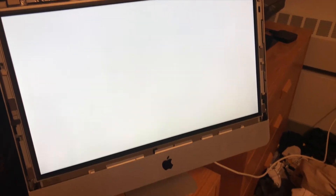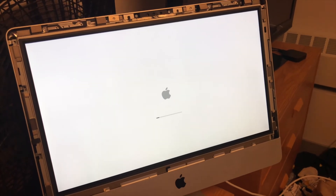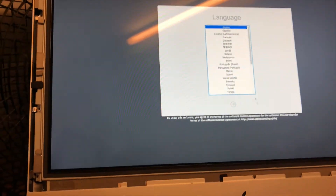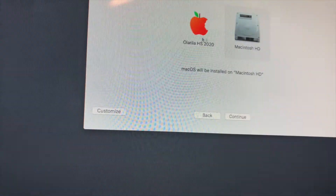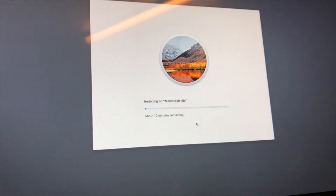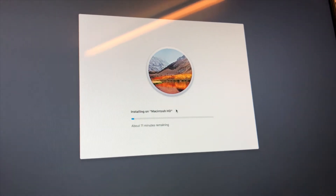Because it doesn't have that Windows partition to fall back on, I'm holding Command Option R. Oh, here we go — Mac OS logo, that's a good thing. This should be booting from the flash drive. So we've got the installation software — that's good. We'll check if the keyboard is connected. I do have a Windows USB keyboard connected as well. We can see this is the USB flash drive here and this is our actual hard drive, so we should be good to install it. It says 12 minutes remaining. Once we have an operating system fully installed, I'll do the Mojave and Catalina ones. It just said it's done with the installation — it's going to restart and we'll have the boot menu.